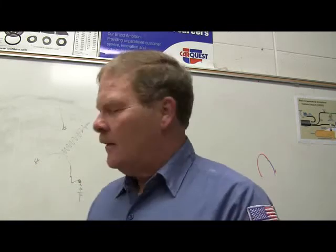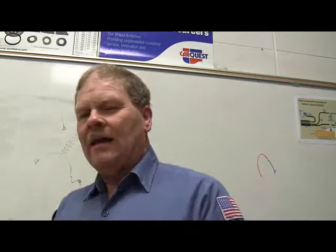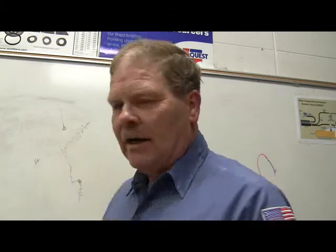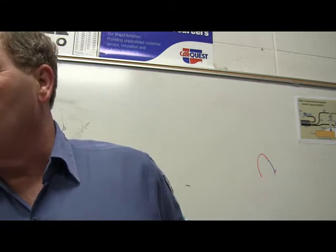Now, if you disconnected the gauge, turned on the key, and you didn't see a light there with your little test light, then you would know that there was either a bad connection between here and the gauge, the gauge is burned out or something like that. And so that third question is true. That is a true question, a true answer on that one there.